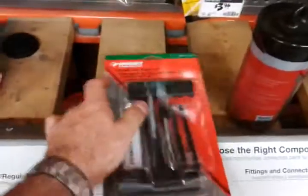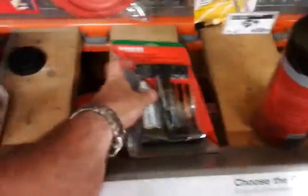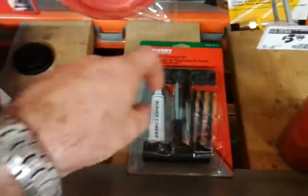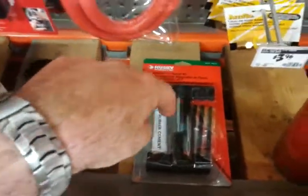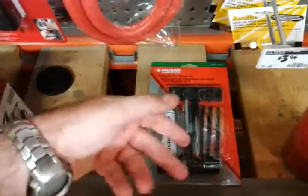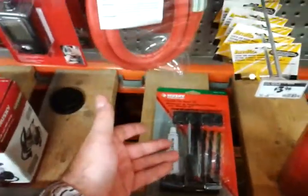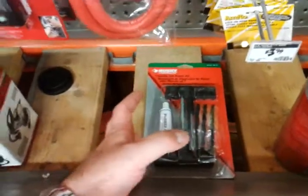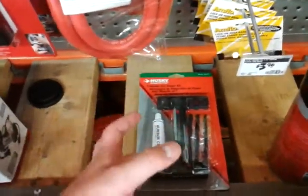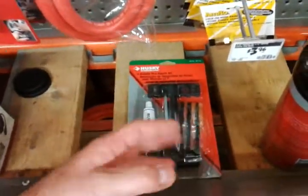Usually what you do is you take it and stick this down here. You basically use the rough tool. You screw it down to basically get the steel belts out of the way of the plug. You have the epoxy, cement, whatever you wish to call it. You can use rubber cement in its place. It all is roughly about the same stuff. It's basically just rubber in a seriously nasty variety of acetone. It evaporates out, leaves rubber behind.